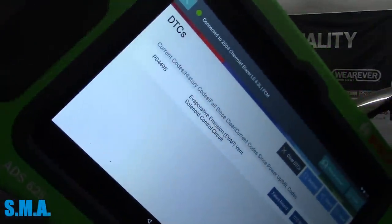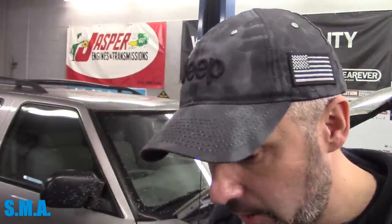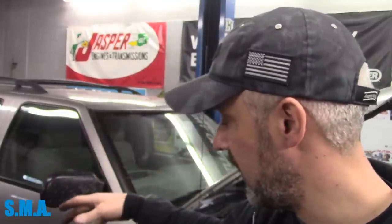Hey there viewers, welcome back to the Selfmade Auto Channel. We've got a 2004 Chevrolet Blazer with a 4.3, and it's not completely rotted out which is amazing, but the engine light is on with an evap code. It's the classic P0449 — a vent solenoid control circuit — which 98% of the time you load up the parts cannon, heave a vent solenoid at it and you're good to go. However, doing my due diligence, I went to check it and got nothing back there. It's under the spare tire on these things, so spare tire down, let's go back and I'll show you.